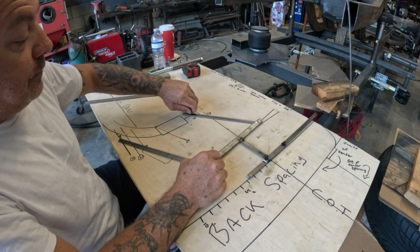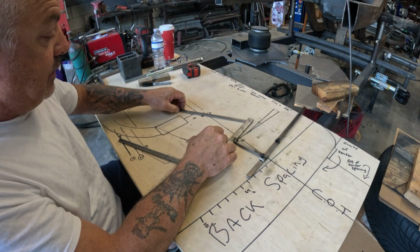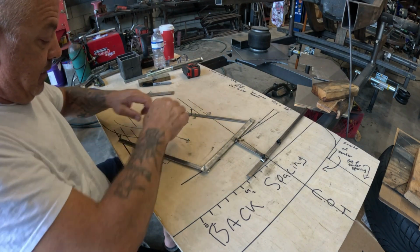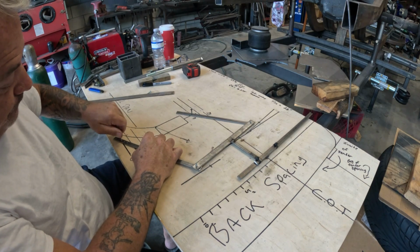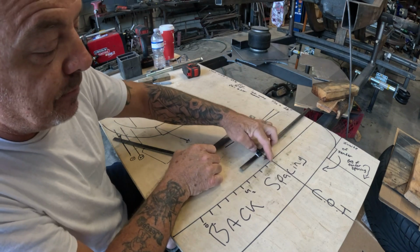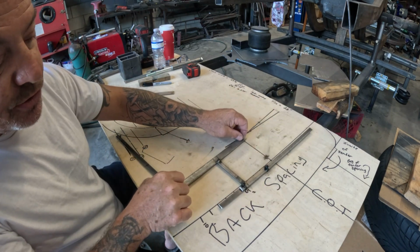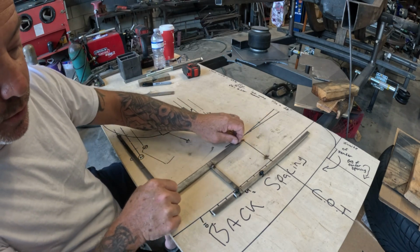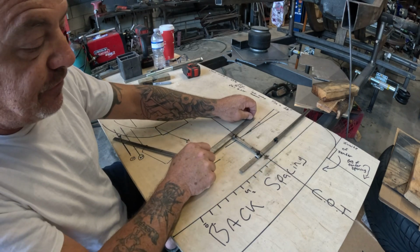What we do is we go, okay, let's go in 1 inch and test it. So go here. Now we go here, like so. Now we moved it in 1 inch. We put it back on our center mark as the suspension's aired out. We go ahead and raise the truck up and we say, oh shit, she's still coming into play. It's not gonna work right there. We basically need another 1/2 inch.